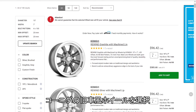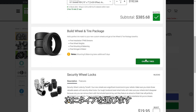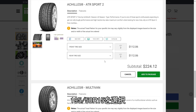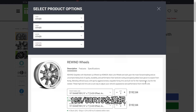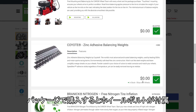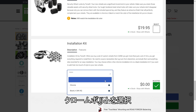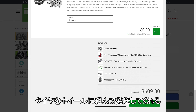We knew that the Miata wheels at 40mm positive offset are fine for the front, but they don't work on the back — they hit the inside of the fender well. So we went with 20mm offset. We found the Koenigs, we knew we wanted those, and they were a nice price. We then chose 195/50R15 tires at the price we wanted. What was nice about the website is it also included a free set of lug nuts for the entire car, and we picked chrome. So these came to us completely ready to go on the car.